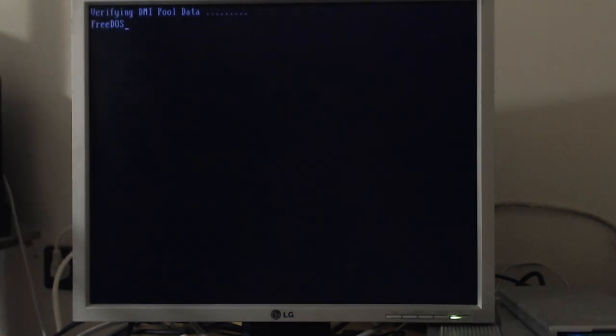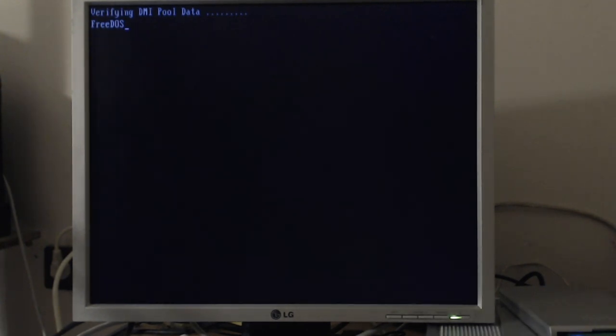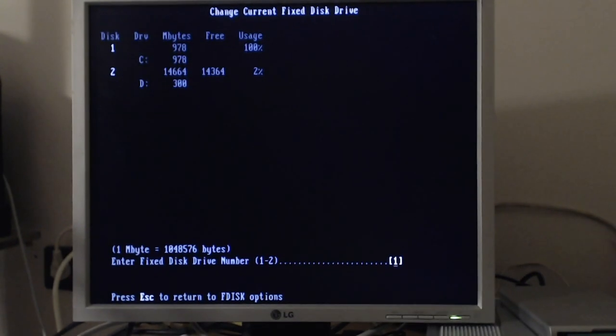To be sure, we also should probably replace the command.com again, because I think sys copies over command.com and under FreeDOS, I think it's kernel.sys. In the worst case, we gonna have to simply remove all files again to make sure that there is no trace of FreeDOS left. We just want MS-DOS 8 on here. So, is everything detected properly? Perfect. Yes. Good. So that means sys c.